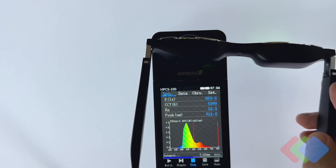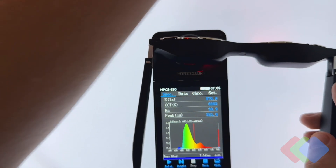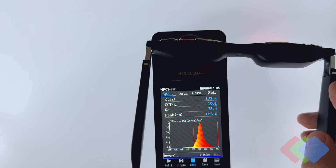Despite having a peak around 520 nanometers, we have a very broad green shoulder, especially in the blue, and quite a bit of output at the 630 side. And then finally, pure red — Sony does a decent job with a 630 nanometer peak, but a slightly larger full width half max than blue. Each panel will have different outputs based on the specific OLED material their device uses.